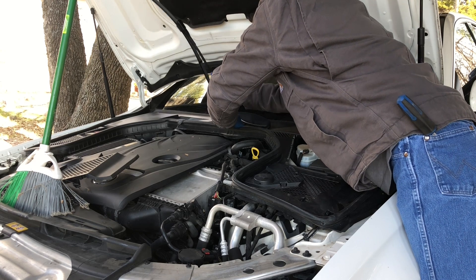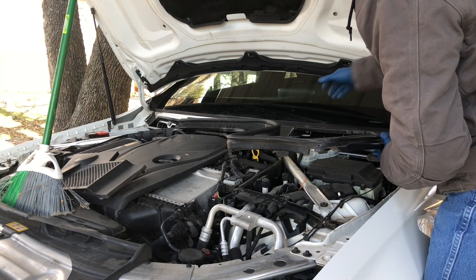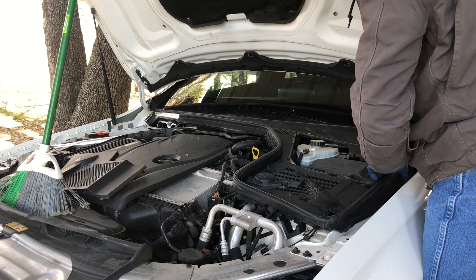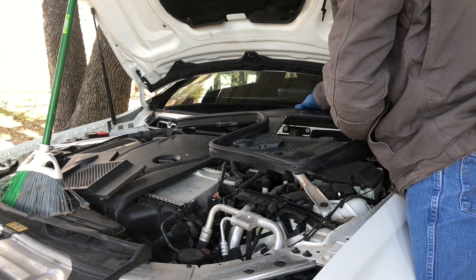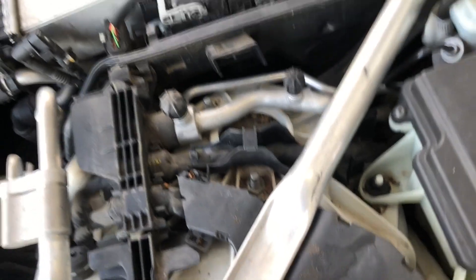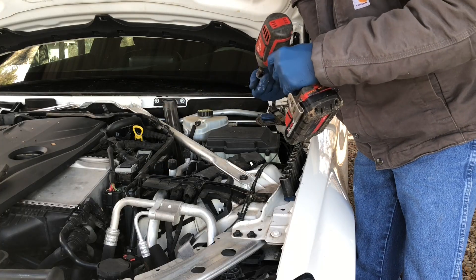This is what put this one in a bind. The back of this slips in under the windshield, kind of like a piece of weatherstripping. It sits in this little groove — kind of peel and wiggle, wiggle and peel, whichever one is easier. Just like that. There's a little plastic piece underneath here. Here we have the top of our strut — a bolt right here, bolt right there, and a bolt right there. It's 16mm, which is the same as 5/8.